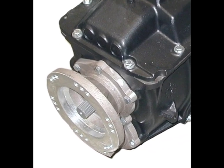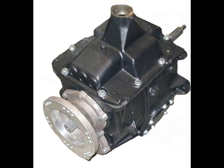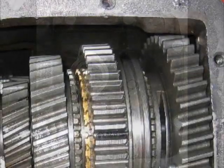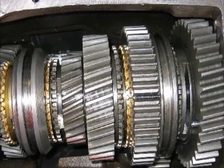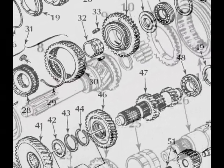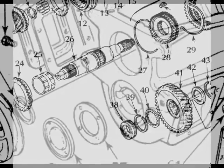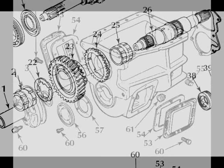The SM465 is an outstanding heavy-duty truck transmission designed and used in one-half and three-quarter ton trucks, as well as trucks exceeding one ton. It was made by General Motors from 1968 to 1991. They are found primarily in GM and Chevrolet trucks, Blazers, Suburbans, and many other models falling under the quarter-ton to one-and-a-half-ton platforms. The SM465 is an intelligently designed and very well-built transmission, and remains easy to locate and generally inexpensive to buy and maintain. Its strength, relatively short size, and gearing make it a good choice for a variety of on-road and off-road situations.